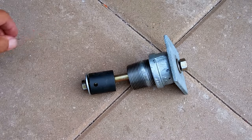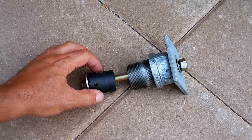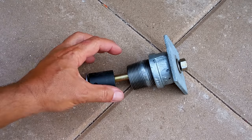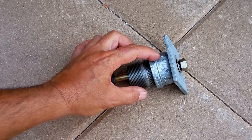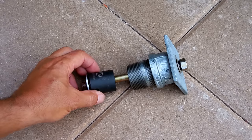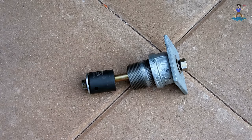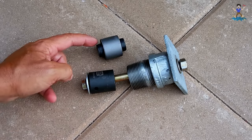Keep in mind this tool is designed for my vehicle to change the bushings on the control arm and trailing arm. If you have larger bushings, you're going to want to use an inch-and-a-half pipe with an inch-and-a-half cap, and then use a different size socket. This socket here is an impact socket I picked up for around five bucks at Home Depot — it fits just slightly smaller than the bushing that's inside.